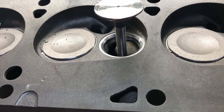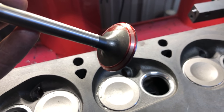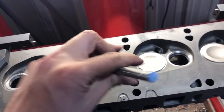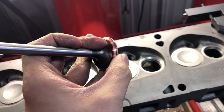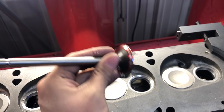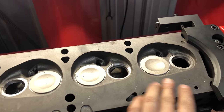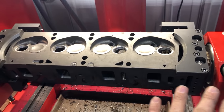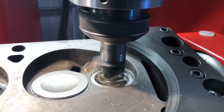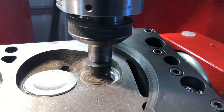You can see it's got all three angles and looks real nice. The seat is contacting the valve right in the middle of the valve face - that's what we like for a stock rebuild. In performance applications you'd push the seat contact out to the very edge of the valve, but for a stock rebuild we keep it in the middle. I've got my zero set so now I can cut the last three exhaust valves to the same depth. Toward the end you'll hear a little chatter because I only had one hand on the spindle feed while recording.